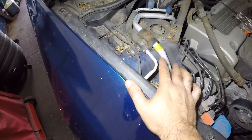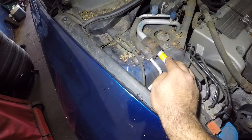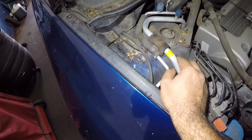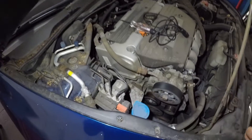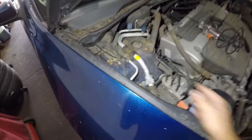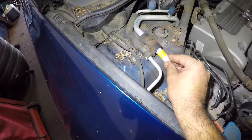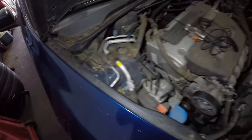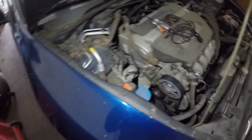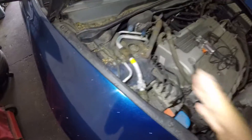The skinny line is the high pressure side and the fat one is the low pressure. The fat one usually gets cold, so a lot of people tell me their AC compressor comes on — but if I ask you if the line is cold and you touch it, this line should be cold if your AC is working. Your fans should be running on the radiator. But some people say their AC compressor comes on but the line is hot.